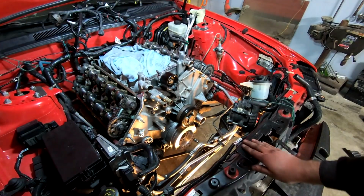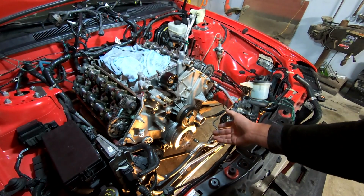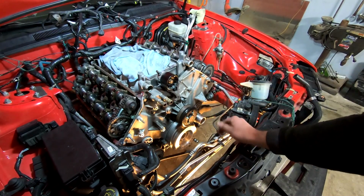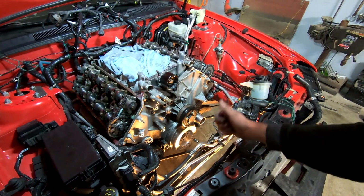All right, so if you're not doing it, it's a great time to install that crank saver stud. But pretty much once you go to the bottom, that's actually the bottom of the threads on it, so that means it was all the way in, and you get plenty of threads on the nut itself. So torque down to 130 foot-pounds, it's good to go.